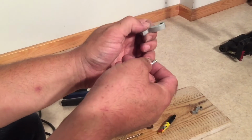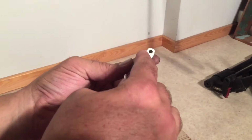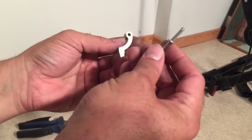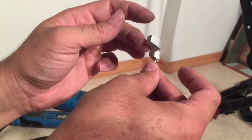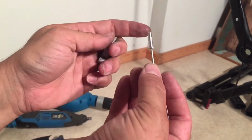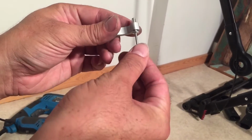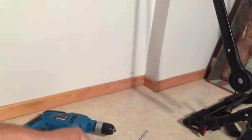If you look at these arms, the rest of the pegs from the plastic disc is there, so we're going to pop them out. And when you're looking at your rivets, when you're trying to decide on your rivet size, it needs to be something that's going to slide nicely in and can also move. And these rivets don't have sizes written on them, so I can't tell you what that is. But usually when you buy a rivet gun, it comes with a variety of different sizes. And what we're looking for now is width, because we're going to slice off the extra bit of the rivet.